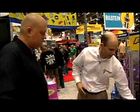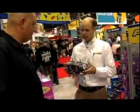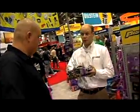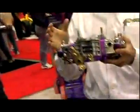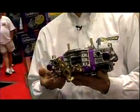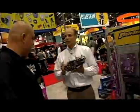Let me show you a little bit about our carburetor, which actually incorporates this nice lightweight aluminum main body. Here you go, our number one seller, the 750 CFM race series carburetor. This carburetor includes this lightweight aluminum main body, which is great for dissipating heat, better than zinc. Also billet metering blocks, billet base plate, die cast fuel bowls with sight glass windows. I see that. All these features.